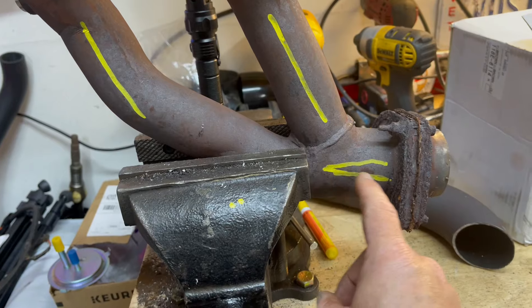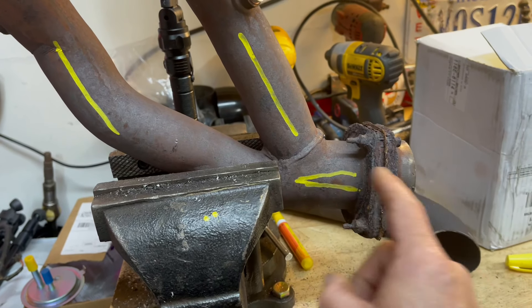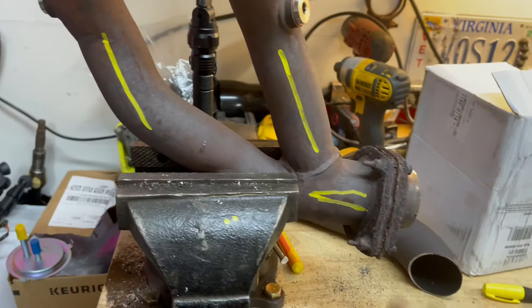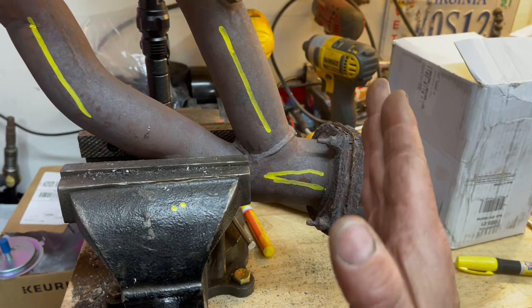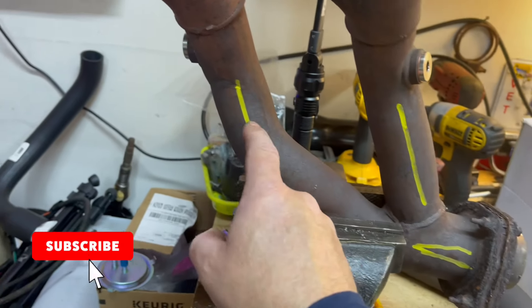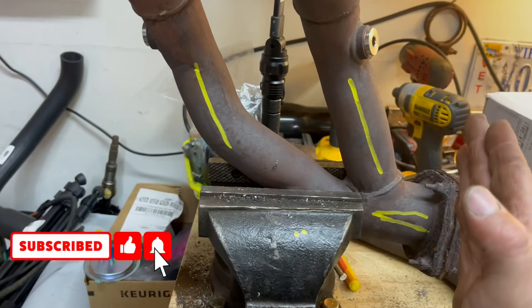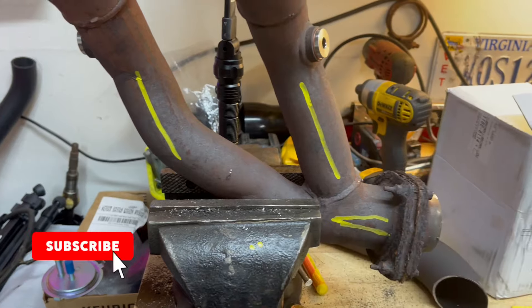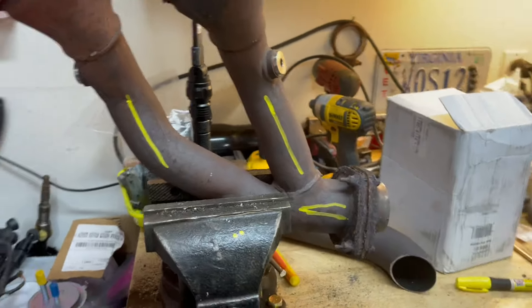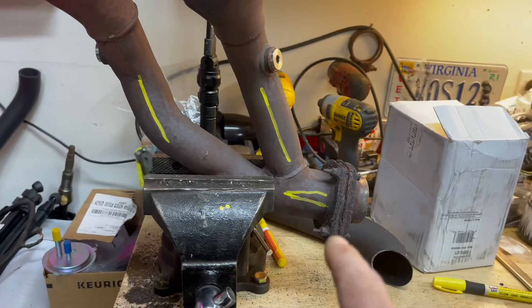The lines represent straight-line marks on the exhaust. This is the way the exhaust angles down now and comes out - I need it to come out at the line up above. I'm going to cut this flange off first and see if I can tilt it, but I still need to take half an inch out here and a half inch out here if I'm successful in getting that flange to pull about 45 degrees. So I'm going to get to cutting and then try to weld it back up.